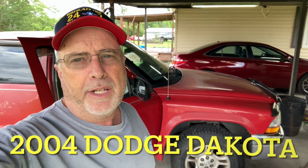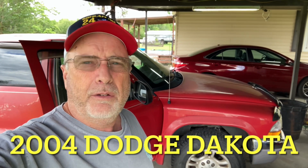Guys, I'm gonna throw a quick video on here. Got in the Dakota the other day, leaving work, and my blower on the AC quit. This is a common thing for the Dakota and Durango. I had this problem about a year and a half ago, and it turned out to be the ignition switch went bad. Even though it was making everything work, cranking, everything was working good, the fan wouldn't work.